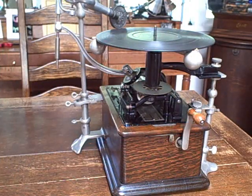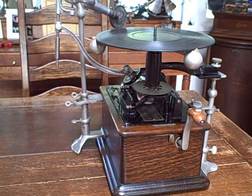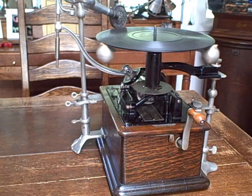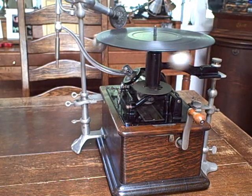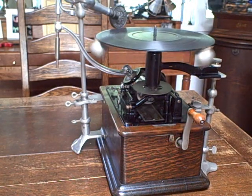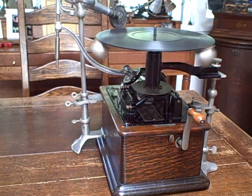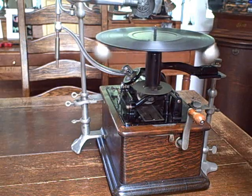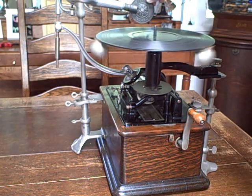Despite advertising claims for great simplicity, this is actually a very difficult machine to adjust. Slightest variation in adjustments will cause it to stop altogether. You can spend literally hours trying to get it to work at all. It takes a little time for the centrifugal force to kick in with the turntable balls to get the disc spinning. And as soon as you put the tone arm down, the weight really adds drag.